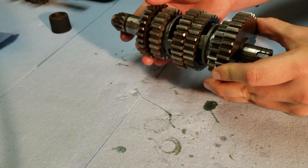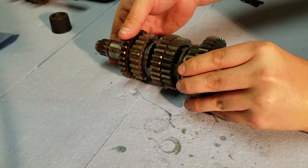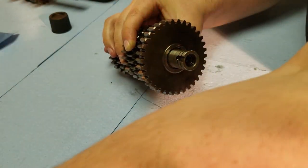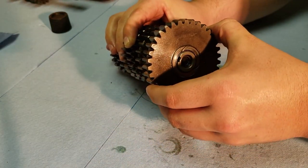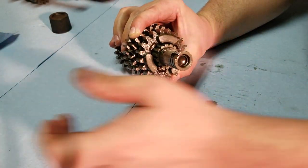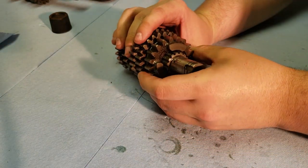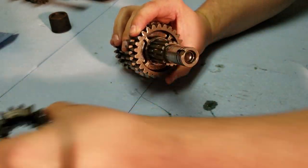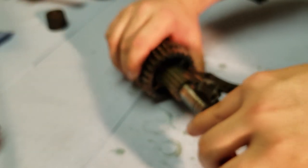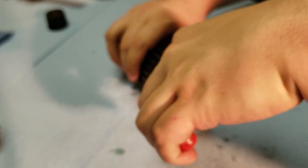This is the drive axle — this is a lot easier to take apart than the main axle, so I'm going to do it next. Starting off, I'm going to go ahead and take off the washer, then the first wheel gear. I'm going to lay these out in order and face them down so I know which orientation they're supposed to go. Now the fifth wheel gear. And then we have this circlip in there, so I use the same snap ring pliers — reach down in there, separate them, and pull them straight out.